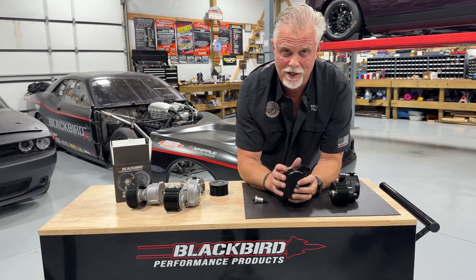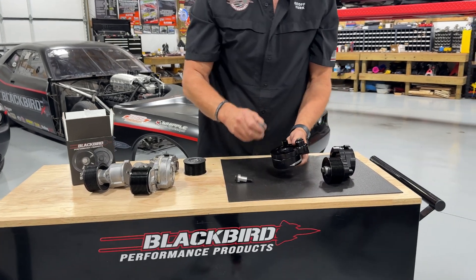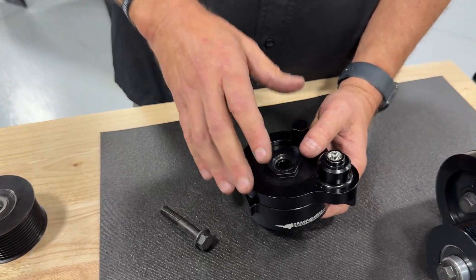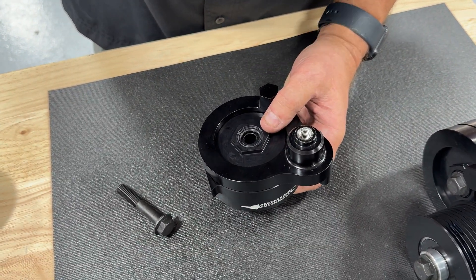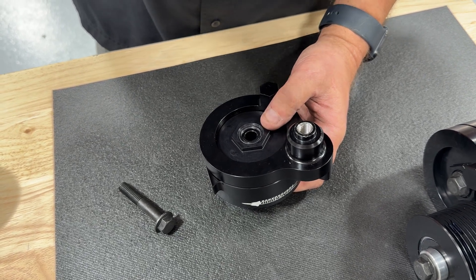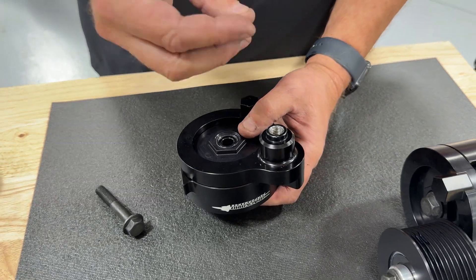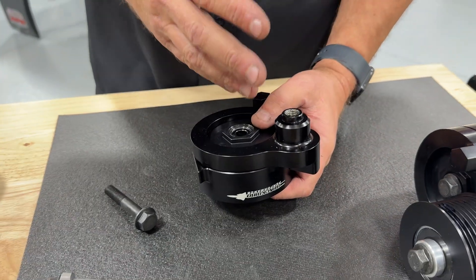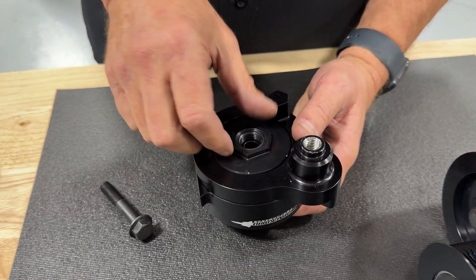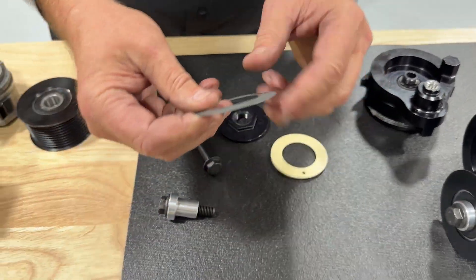What's really detrimental to how these belt systems work is alignment and structural soundness, plus this big range of motion we have. What's inside? It takes more than just a stiffer spring. This has the right spring, but like a car — if you put the right spring in and take the shocks off, that's a problem. Some aftermarket tensioners have essentially not done a good job with the damping — they've put in a bigger spring and taken the shocks off, and the thing goes out of control. We've been very careful about incorporating proper damping.